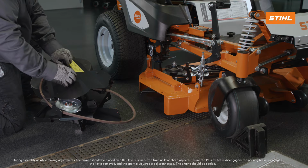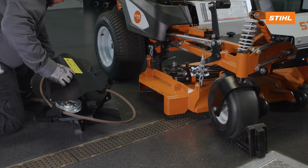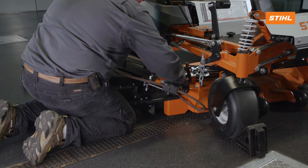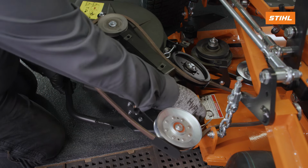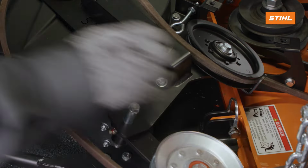Before installing the blower to the mower deck, remove the blower hood. Retain the 3 knobs. Use the linch pins to install the blower onto the mower deck. The linch pins fit into the same holes that the chute mount rod was installed. Install the linch pins in the direction shown.